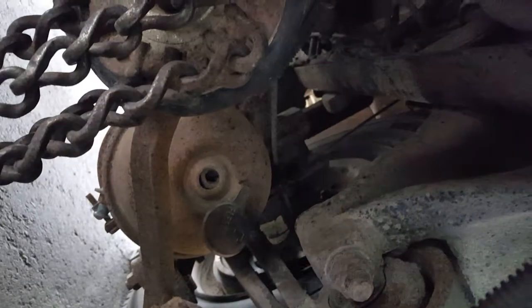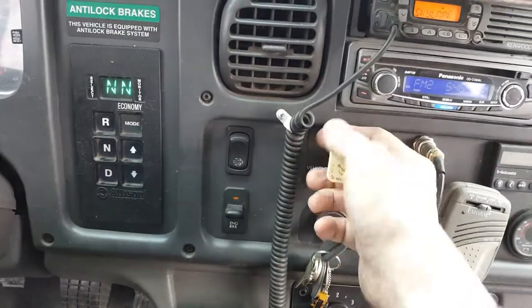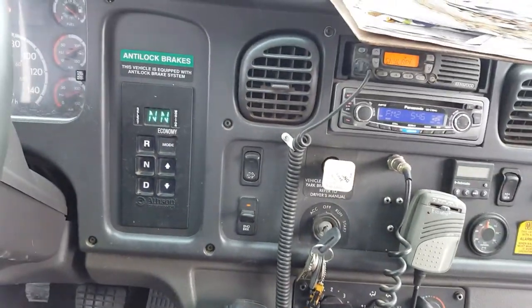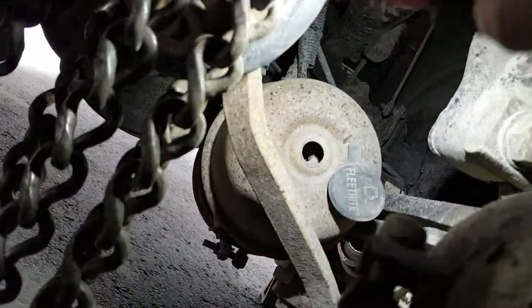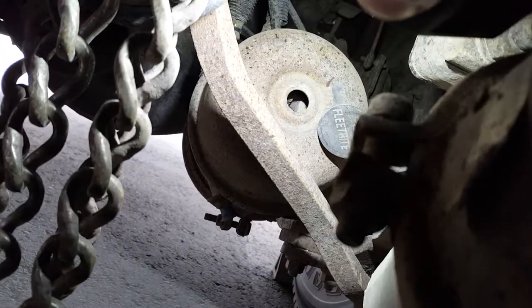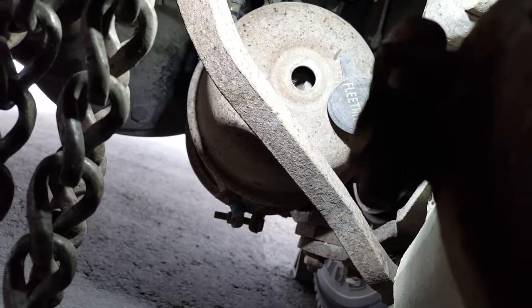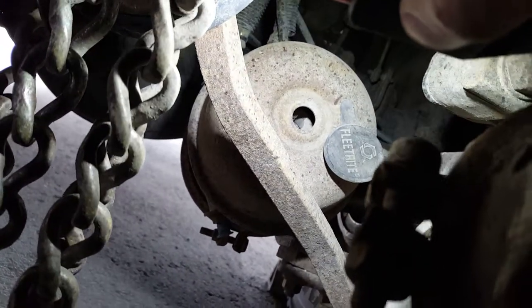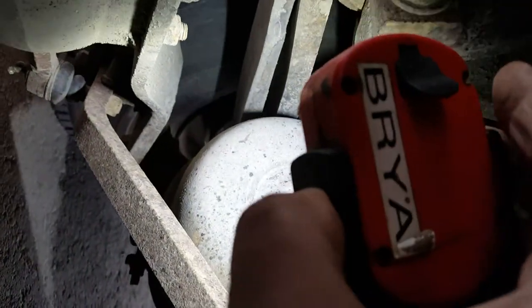So we're going to apply the spring brakes and have another look. Applying spring brakes — okay, so there's no air, springs are totally applied. So with brakes applied, you can see on this driver's side there isn't much travel happening. There's not much application stroke there with the air release — it's supposed to be fully applied. And this one here, it's further into the pot.